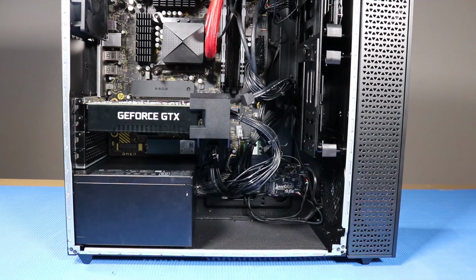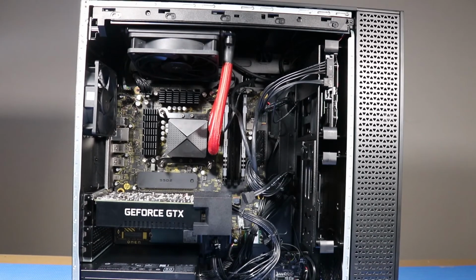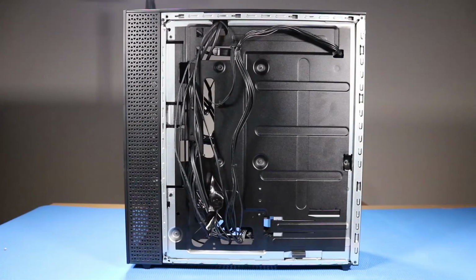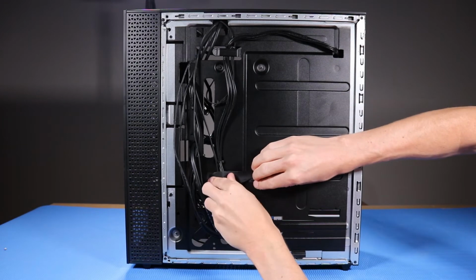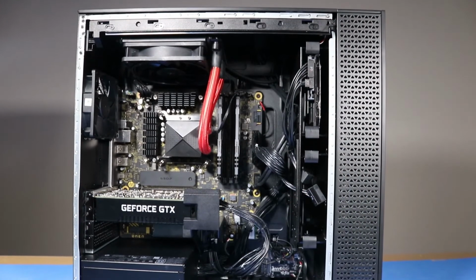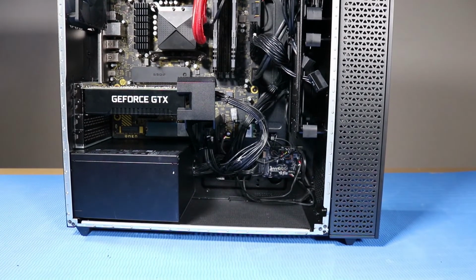As you complete the replacement of a part for the desktop, you should ensure that all of the cables are correctly routed. The interior of the system should never look like this after a service event. As you route any cables that you've connected back into position, be sure to use the clips, hooks, and tape that are provided on the chassis for this purpose. This prevents the possibility of cables snagging or sagging when the desktop is moved. It also helps ensure clear sight and access to the components, should any further troubleshooting or servicing be needed.